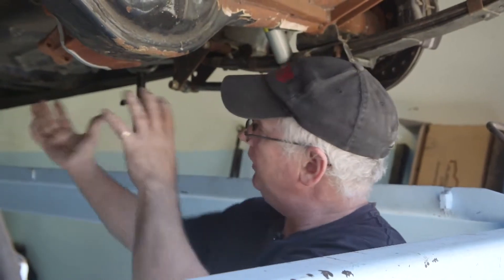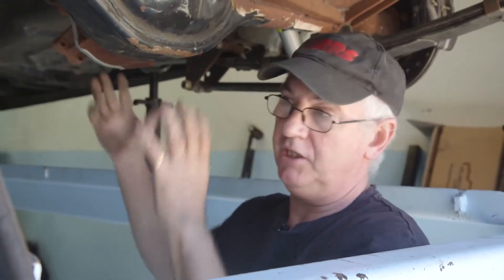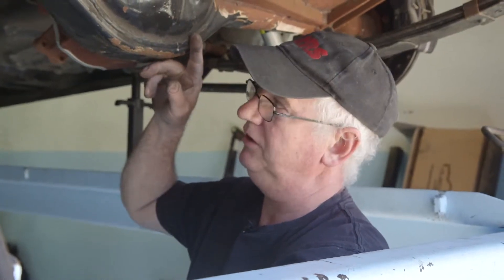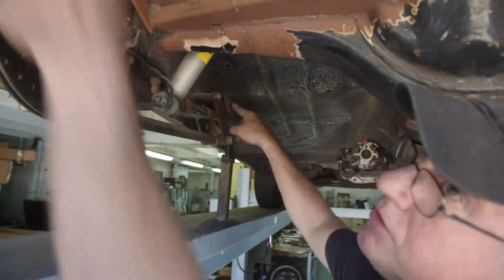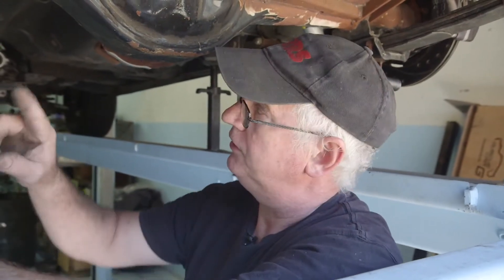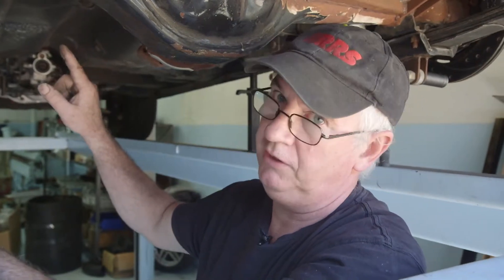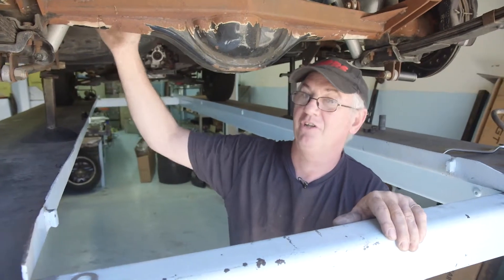You want the weight to be ideally in the middle of the car — obviously that isn't always the case, but there are geometric ways of producing that and changing the driving characteristic of what these used to drive like, which is ploughing understeer and then dangerous oversteer as you exit the turn. This whole setup transfers its forces into the chassis via these points. When you design a rear end correctly, the forces are decreased, the chassis acts like it's a stiffer one, and all of the components that you bolt in, rather than being a detriment, become an advantage. It requires a little bit more design understanding of how monocoque chassis work. So we're about to pull all this out now, fit the new LRS 3-link, and show you how much better it is.